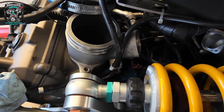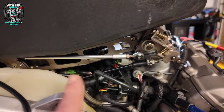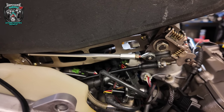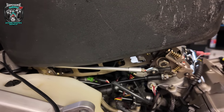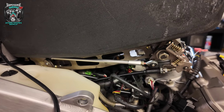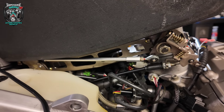Let's get it back together, check for vacuum leaks, and then investigate the TPS next. So I've got the injectors back in and everything connected up. The fuel injection on this is sequential - the injectors are timed to fire at a certain point in the engine stroke, which is why there's a cam sensor and a crank sensor. The injectors need to fire at the right point. If you fire it at the wrong time when the inlet valve is shut, it's just going to exacerbate the wetting of the manifold wall.